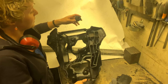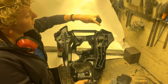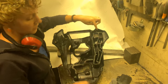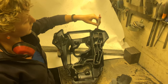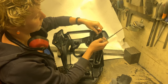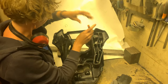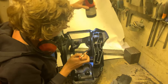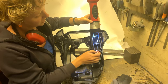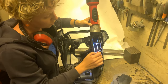So what basically happens, we have our little friend here again. Our fumes go through here, enter here, and go to the other side under, like a little tunnel. This is where the Evap is connecting. And here we have a little felt, which is basically only hindering the coal from falling into here. So we arrive in here, down there, we have a little hole here that connects us to the next chamber. You can see it maybe if I put my light here, it lets through here. So you have the next chamber here, and here's a little wall where the fumes go over.